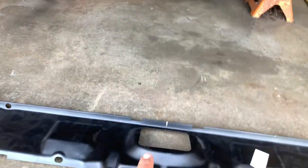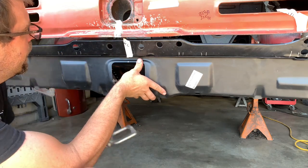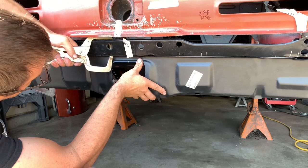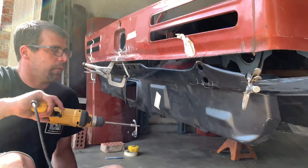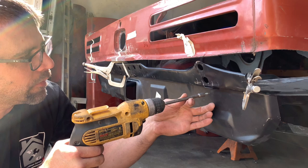Let's get it clamped in place to see how well it fits. Center line — that's pretty self-explanatory. About a quarter inch — feels like it kind of fell into place. Get in underneath here and you can see how the frame rails pulled up real tight to the tail panel, same as the fuel tank support straps. That's looking really nice for fitment. Straight up across the back you can see the quarter inch flange there, looking really good. I'm going to put some screws through the panel and into these things here to tie it to the back of the car.